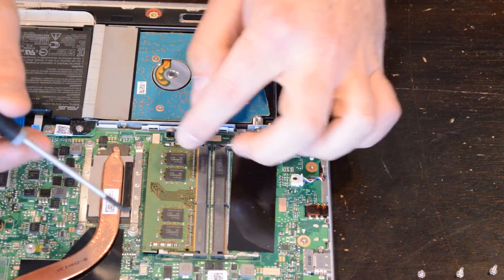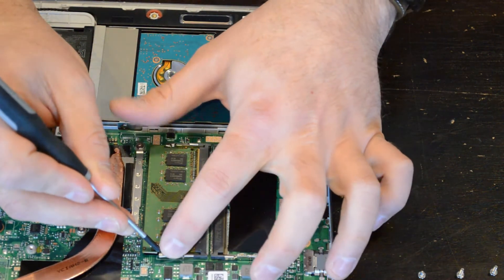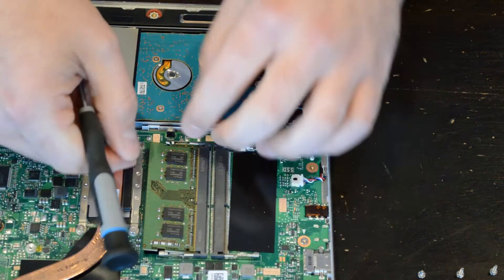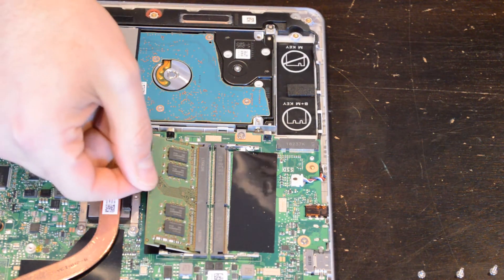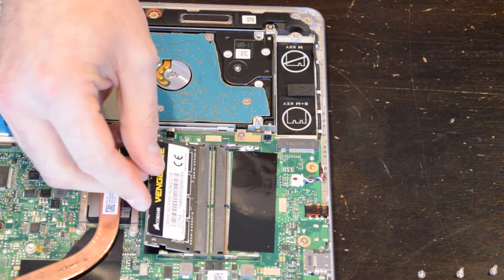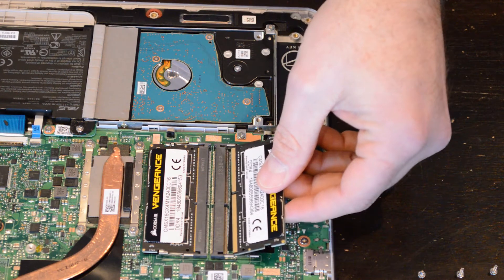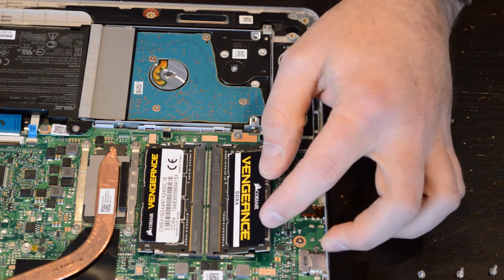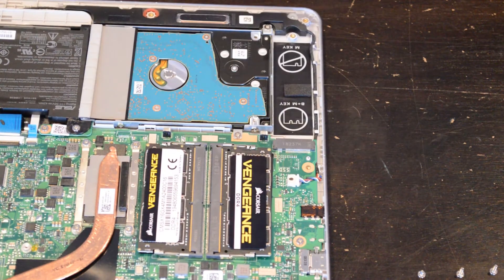It is purely as easy as this. The RAM is held in by little clips on the edges, so we're going to push that clip out just a little bit. That stick of RAM, once it clears those clips, will pop up almost like a little elastic. We're simply going to remove that one eight gigabyte chip, put in a 16 gigabyte and snap it down. On the other side, the other 16 gigabyte — it does only go in one direction — snap it down. We've now gone from eight gigabytes of RAM to 32 gigabytes just that quickly.